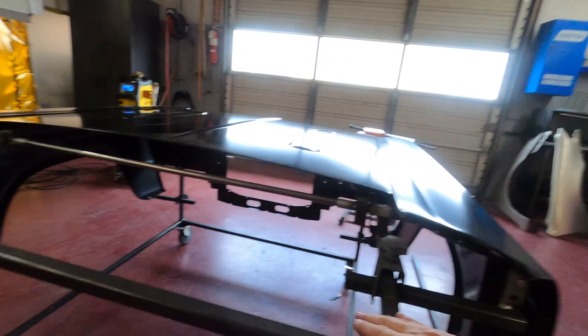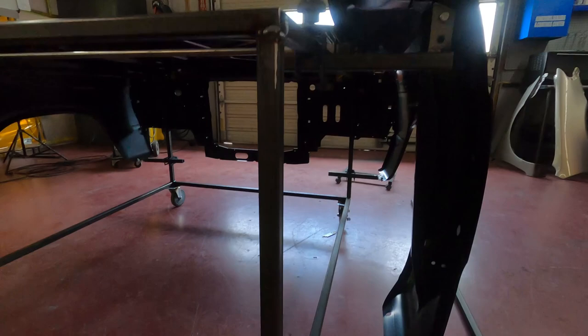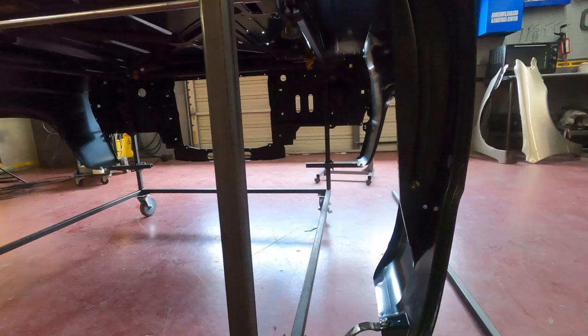Basically, what I did is took measurements from the fenders and transferred that to square tubing from a local metal supply — not very expensive. My dimensions are 27 inches high, 50 inches wide, and 56 or 57 inches long. That gives me a versatile stand where I can mount any type of panel. I used the square tubing and these arms from the Astro stand — you can go to astro-pneumatic.com, send an email to customer service or call their 800 number and say you want to buy some extra parts. They'll sell them to you at a reasonable price.